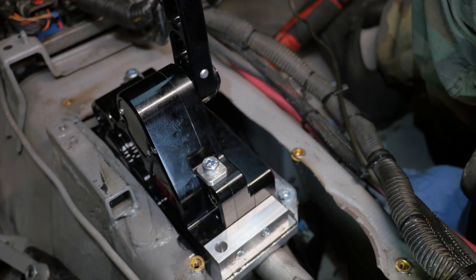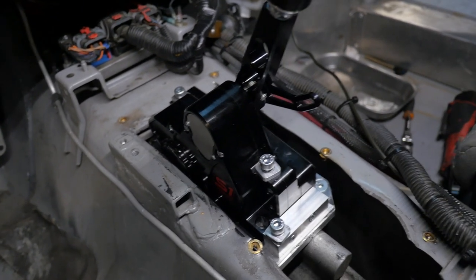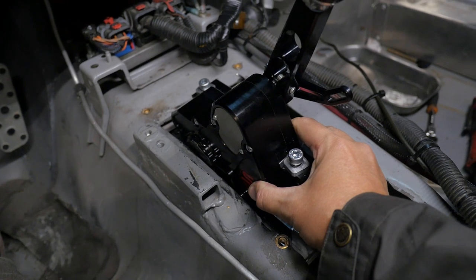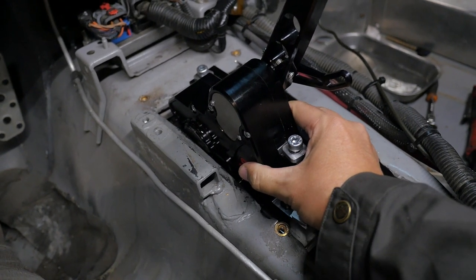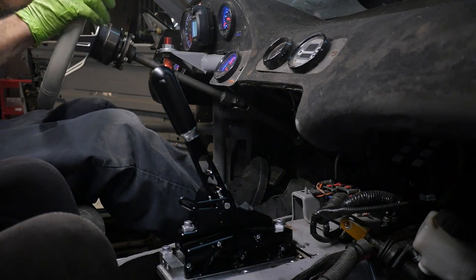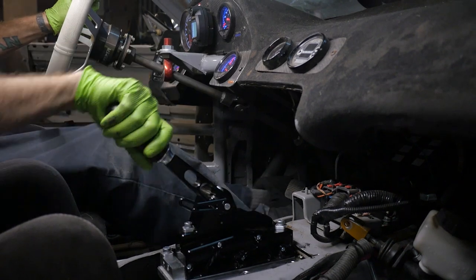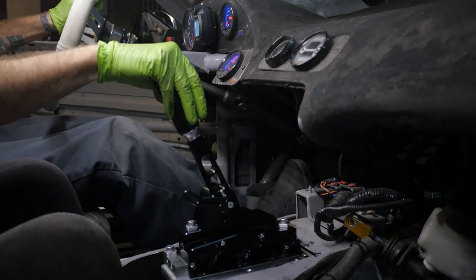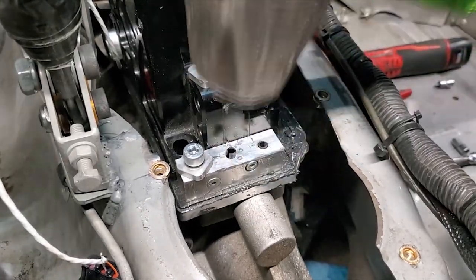We had to modify just a bit and use a shorter bolt on the front left corner, and there should be three others that do fit just fine. You will now need to make millimeter adjustments to get the shifting just right. If you're having issues getting into odd gears, move it forward just a little bit. If you can't get it into even gears, move it backwards. For us, it wanted to be over as far to the left as possible. Make sure to test the car in the air with the engine on, going through each gear, and then back down into neutral and finally reverse.